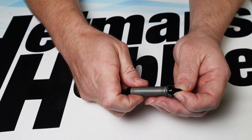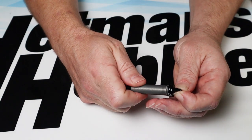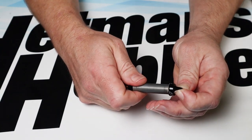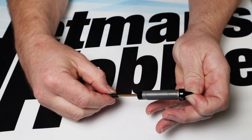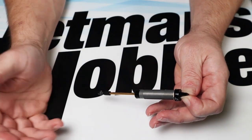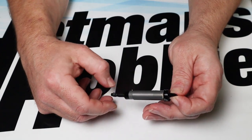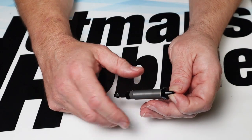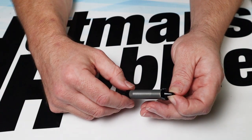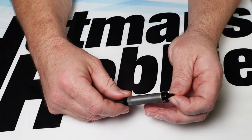After giving it a couple of seconds, tighten the shock body. You can see there's still more air coming out while I'm holding the shock shaft fully compressed — then tighten the shock and once it's tight you have a perfectly bled shock. It's smooth, no air bubbles, no rebound. This is basically a dead shock, which is what I like — I don't want the shock acting on the suspension. If the shock is pushing out the shaft there's probably a little too much oil in; just loosen the shock cap a little bit and bleed a little more oil and air out. That's the basics of bleeding a bladder style shock.